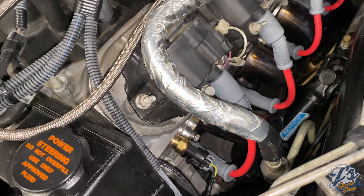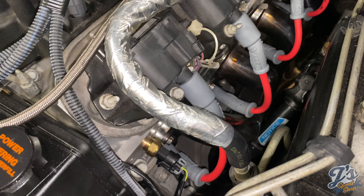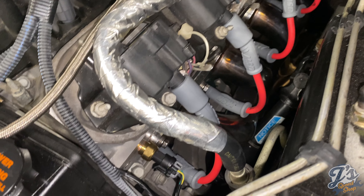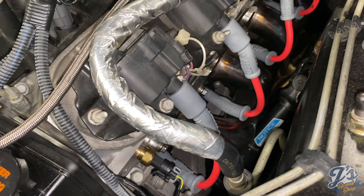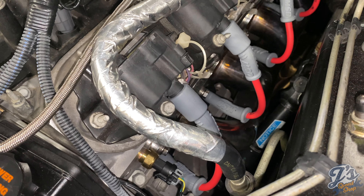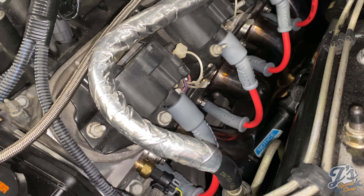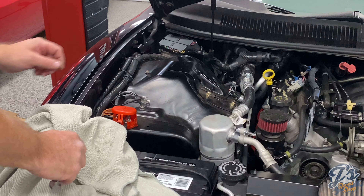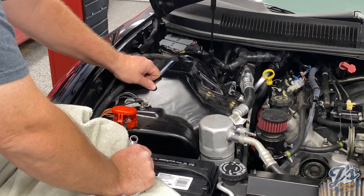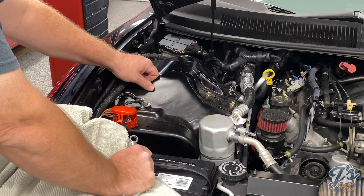While we're installing the new battery cables, we're also throwing the new spark plug wires on — these are MSD wires. The passenger side goes on real easy, easy to get to. The other side is a little more difficult. The reason I'm doing this now is because with the car up on the hoist, I can get to that rear spark plug wire on the passenger side from below — it would be very difficult from the top. Got three spark plug wires on this side from up top; the fourth I'll get from the bottom.